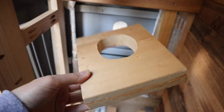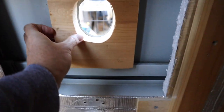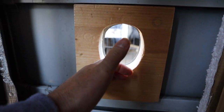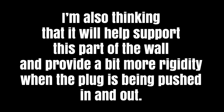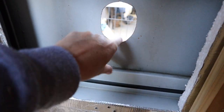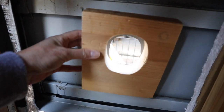I've just cut this piece of timber - it's 30mm thick - and I'm going to glue that into position there. The idea is that it gives the screws a little bit more meat to screw into when I screw the actual inlet in from the other side. I'm going to put some sikaflex on this, do my best to clamp it, and leave it overnight - hopefully that will be enough to stick it on there.